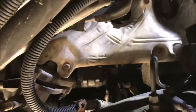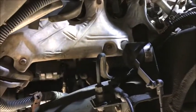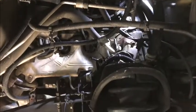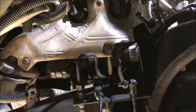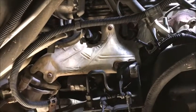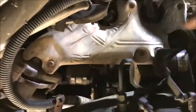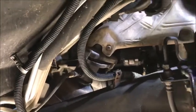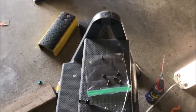This is also a good time to check the motor mount. These 6.2s are notorious for breaking mounts — I already replaced the driver's side, so if this one's bad we'll replace it too since they don't cost much. The heat shield is held on with a bunch of little bolts, so time for a little WD-40 to see if we can get these bolts out without snapping them.